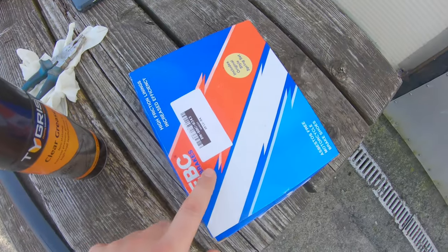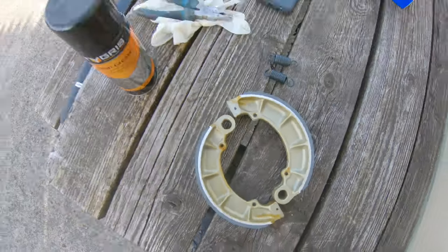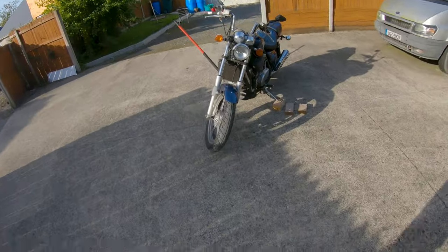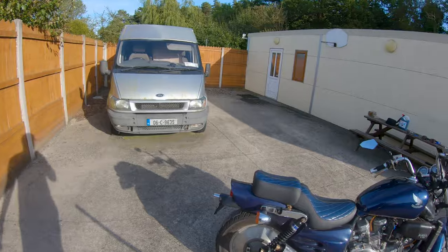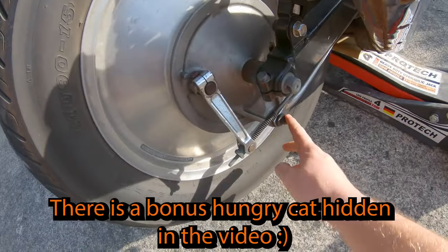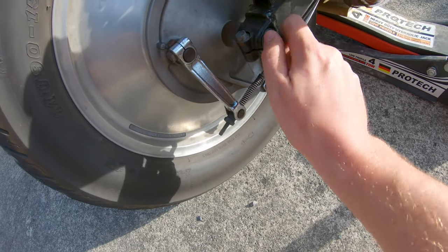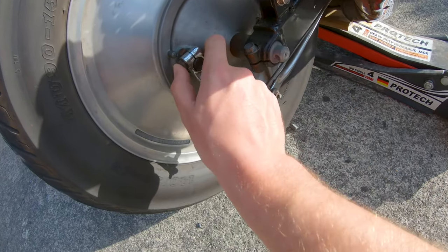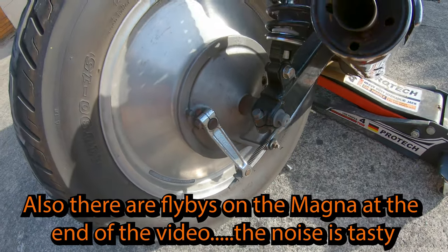Today what we're going to do is change the brake shoes. We have two replacement springs and the brake shoes themselves. I'm on my own today filming — Big J had other things to do. First I'm going to remove the pin from the support hub, loosen out the spline, and take off the brake support.